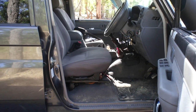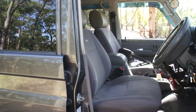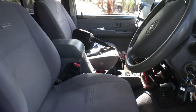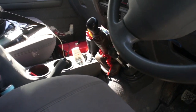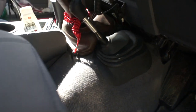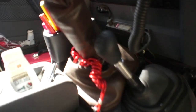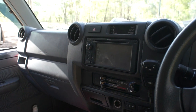Lastly, the interior — not much done in here. We've got the wet seat covers given to us by Bob at East Coast through the seat cover place he uses. A Department of Interiors centre console, which is great just for resting your arm when driving. We've put a second cover over the main shifter to stop the noise coming through — I had this on the 60 when I had the factory overdrive. I've put an extension shaft on the low range stick purely for the leverage getting back to low range; it's made it a lot easier. We've got a UHF tucked in there somewhere.